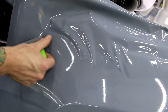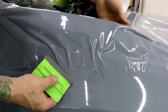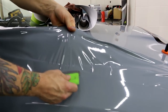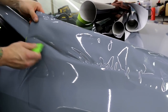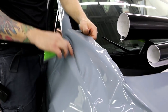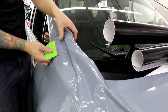I've got all these wrinkles here - pretty easy to squeegee over. If you get one that won't go away, you can just reset the film. Adding a little tension to the film helps keep the wrinkles away, so we just add a bit of tension and keep it nice and smooth. For really fine ones, run your finger over them and they usually go away. That's all to do with pressure. Right here I have resistance from the top - you can see a tension line - so if I push it back I can roll that line instead of stretching.